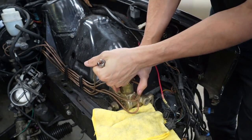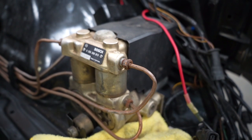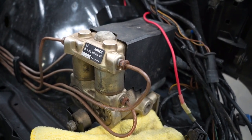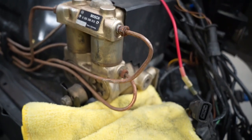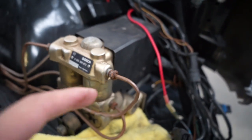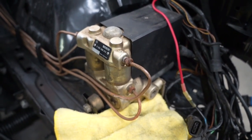Do not use a wire wheel on stock brake nuts — they will start rusting. So just get new ones. It is never worth reusing those. I learned my lesson because if I would have kept driving this with these fittings on there, it would have been bad news. These were scaring me actually, so it's good that I have an excuse to change them.